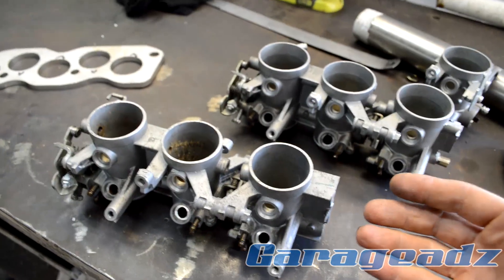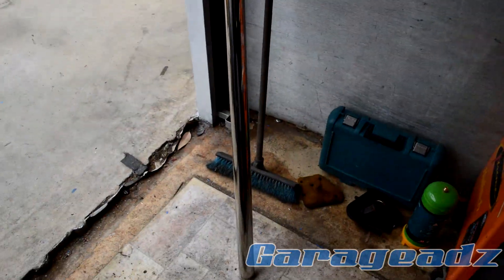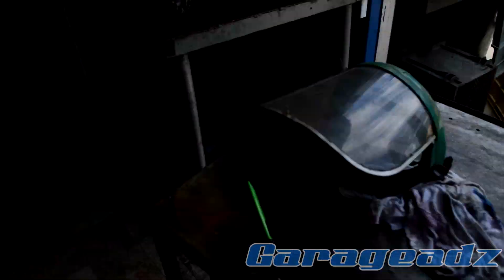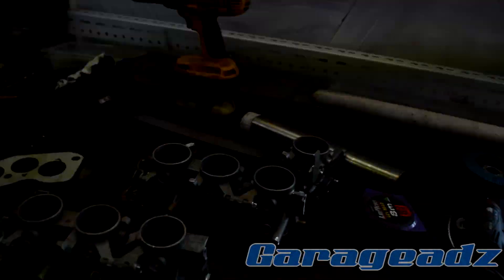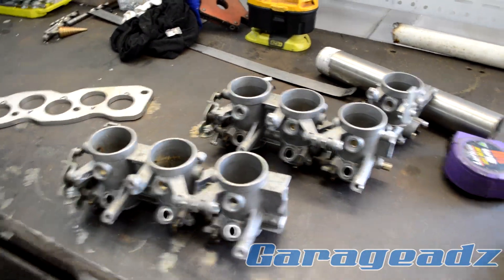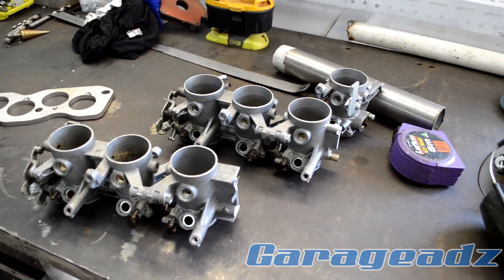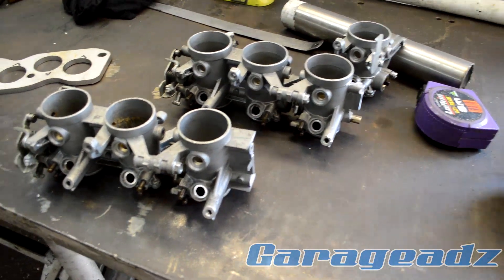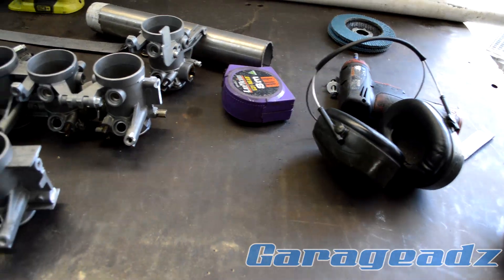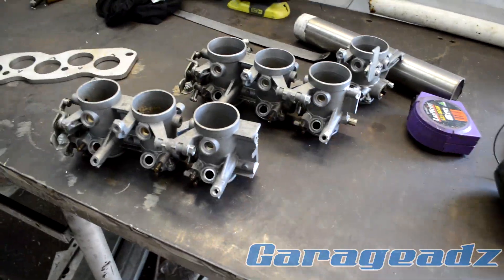The next part is the pipe. I couldn't get the pipe I wanted, so I got some 50mm pipe and I'm just going to make it the right size. I need 42mm ID and the pipe over there is 50mm ID with 1.6mm wall, so I need about 45mm OD. I couldn't get 45mm — I could only get 46mm — so either way I was going to be cutting it. I can always use 50mm pipe everywhere, but you can't always use 45mm.